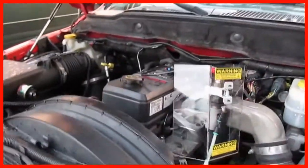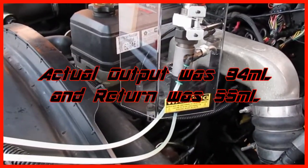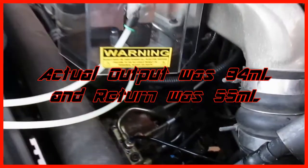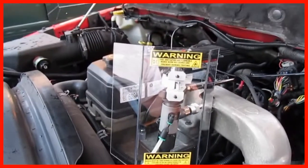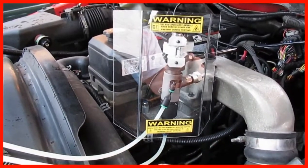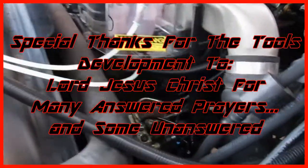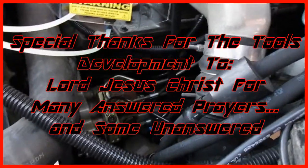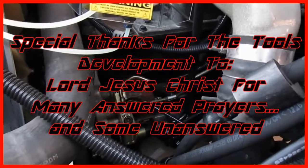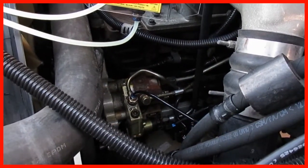So we would have to give this injector a passing grade. There's no other tool like this that I've seen in the world — a unique product from Motorsport Diesel called the Common Rail Mastermind. It does more than just injector testing. Like you saw, we can actually run the truck and maintain the rail pressure with our programming. We can check the relief valve, the rail pressure sensor, measure the flow from the CP3 pump, and do a full common rail system test with that.